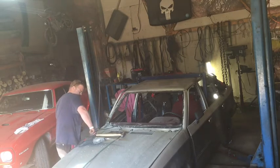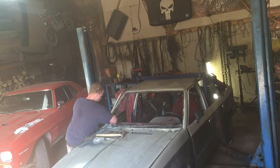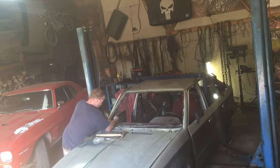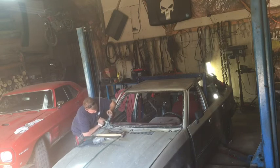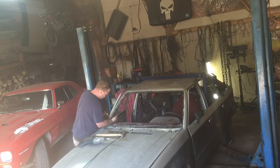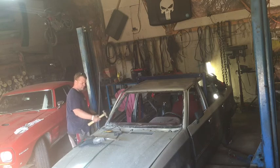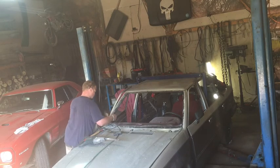I'm actually going to break the blade — you get a new piece for it. Because it's kind of getting dull from all the glass. Glass doesn't like being cut, so it's going to dull any blades that you put into it. Don't be upset if you lose a couple of blades to the glass. Now, this is usually how I do the back windows as well, except the back windows you just hit with a hammer and go around. But this one I was actually able to get out just by slowly applying pressure all the way around it — I guess it's an older car, so it's got an older style of sealant on the back window. Newer cars you can't do that to, so you physically have to cut them out.